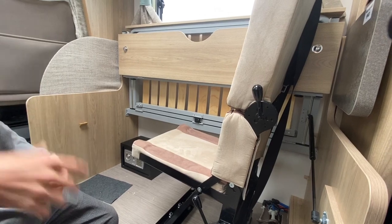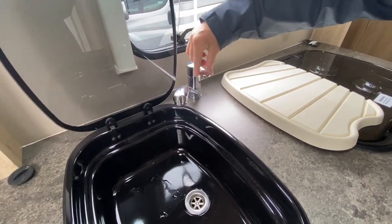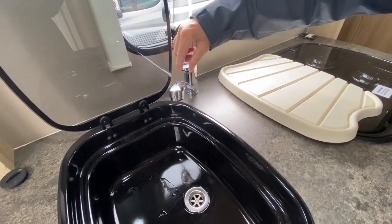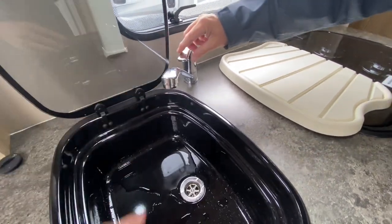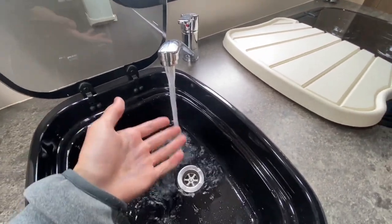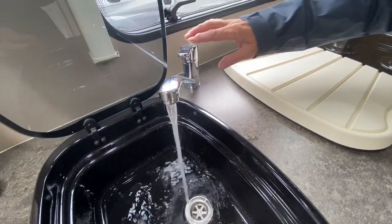You've got the same on the passenger side. For your kitchen tap, make sure the pump is on at the main control panel — you've got a mixer tap for hot and cold. Turn it on and the water will prime; it will cough and splutter if the boiler drain has been open until you get a steady flow.